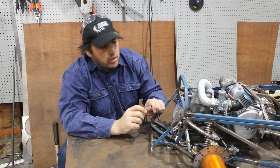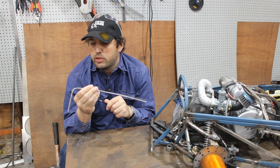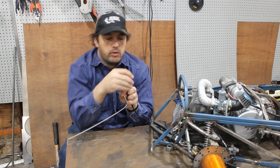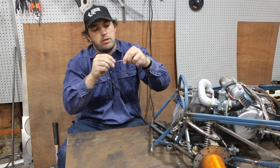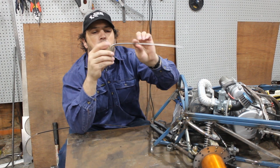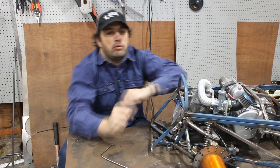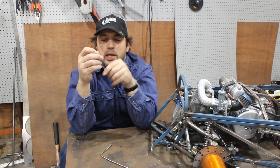What I have to do is — I've got a piece of stainless Bundy line, which is a brake line, and it's the right diameter that the throttle cable can pass through it. That was a test bend, but I'll put a bend in it. There's a piece that will come up and out at a tight angle, and this cable will slide through it quite happily.